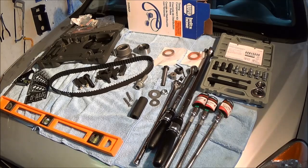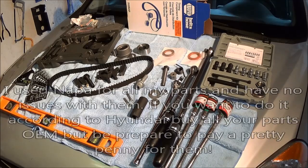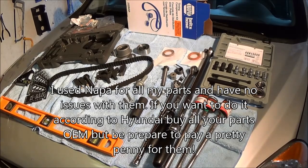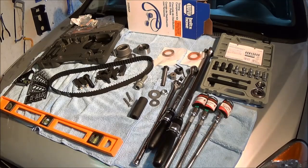Let's get to the parts — we'll zoom in on each part and try to cover the cost and part numbers for you. I'll try to give you accurate information. Go to your local Hyundai dealer and order these parts by giving the make and model of your car. You can order OEM parts or aftermarket. I ordered the NAPA timing belt kit with a belt, tensioner, idler pulley, and seals. I ordered my harmonic balancer bolt, tensioner spring, and tensioner bracket from Hyundai. I've used NAPA belts on this car for four years with no troubles. The Hyundai belt is about $89–$90 just for the belt; I bought this whole NAPA kit for under a hundred bucks.